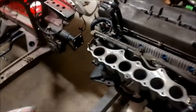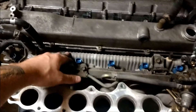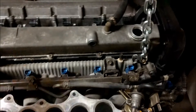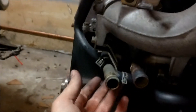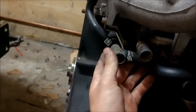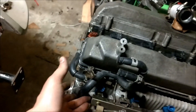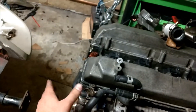The coolant lines I was telling you guys about — I thought they were vacuum lines, but they're actually coolant lines. There's like an old school radiator that goes inside the intake to cool it down, and then it comes back up through here and back into the collector plenum. I'm not sure exactly how it flows, but I need to make sure it all goes back the way it's supposed to. One line goes down with the coolant hoses into the heater core, and the other goes into the collector.